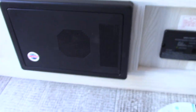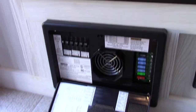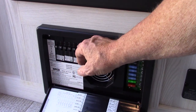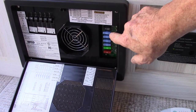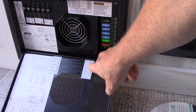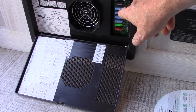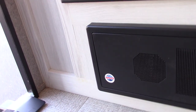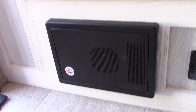The microwave works like any other microwave. This device down here is your power converter — it converts 110 AC to 12-volt DC. You've got regular household-type circuit breakers here, then you convert the power to 12-volt DC, and you've got regular 12-volt fuses — they're all labeled. If these fuses were to blow, they'll actually light up and you can see them glowing through this perforation. As long as you're plugged into power, it's also a battery charger that'll keep your battery charged.